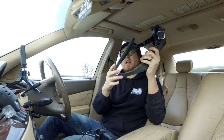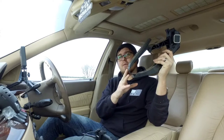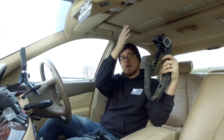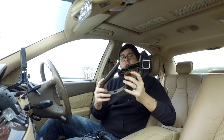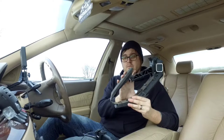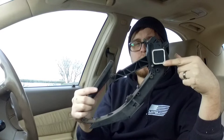Now the pedal is out. You'll notice with pretty much all Mercedes pedals they are hinged from the floor, which means the pivot point of the pedal is from the floor, as opposed to the type that hang down and pivot from above. The way a W220 pedal works - you have the hinge part of the pedal that pushes down and you have this sort of cantilever design. Right here is the part in question - the potentiometer that reads the pedal travel.